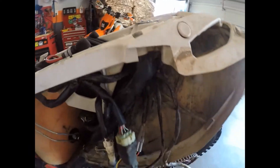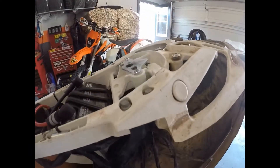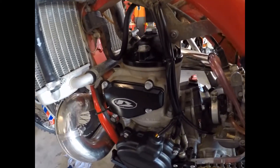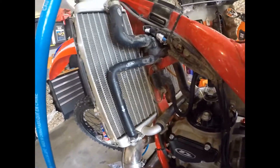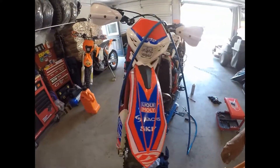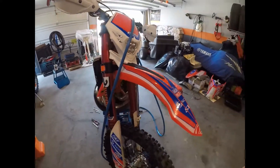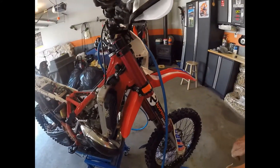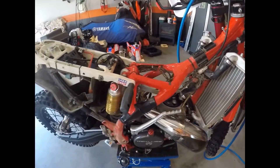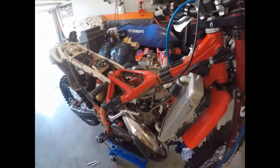I tend to take mine apart every year and clean everything and look for any problems — hence the other reason why it's nice to have a clean bike. I'll probably do a top end this winter since it's got 120 hours. I'm going to take the carb off shortly, lift the swing arm off, give the carb a clean, and do a coolant flush. But yeah, I'm really happy with this purchase. I got rid of the CR250R — sold it to the first person that came to look at it — and acquired this. More to come.